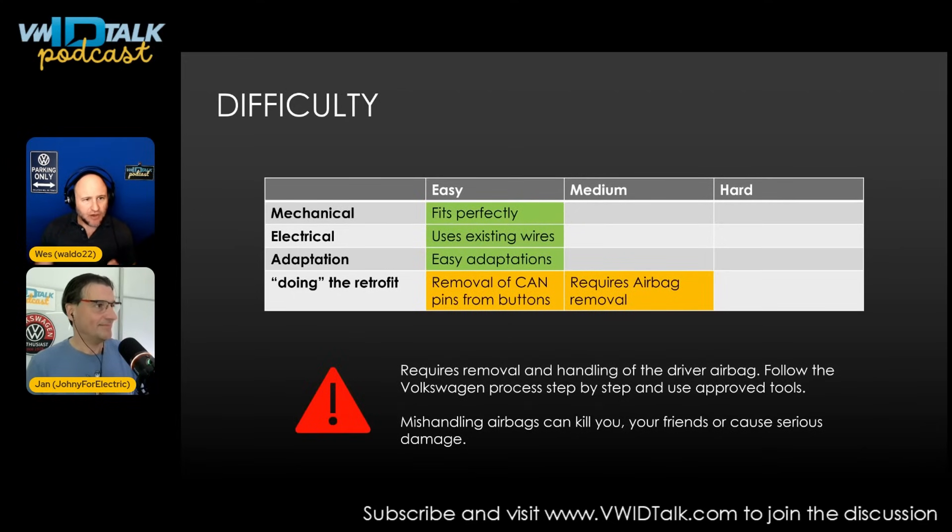This is still a work in progress — we have some things to tweak. The old buttons communicate via the LIN bus; the new capacitive touch buttons communicate via CAN. We have not yet been able to locate a set of push buttons that communicate over CAN. When you connect up the wiring harness and those two CAN pins are active, it causes your horn to sound constantly, which is not good. We had to modify that and remove the CAN pins, and hopefully we can find a workaround in the future.